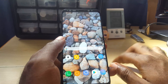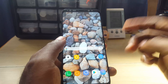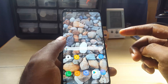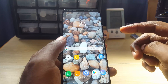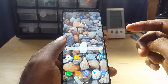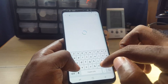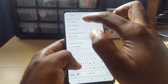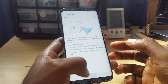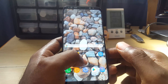You could also boot into safe mode — I'll put a link on screen — and test to see which apps could be causing the issue. If the iris scanner works in safe mode, it means a third-party app on your phone is causing the crash. Also, go into Settings and search for Smart Stay — if Smart Stay is on, turn it off, as it can sometimes cause issues. Then go ahead and test the iris scanner again.